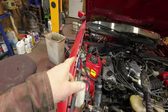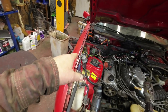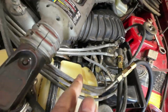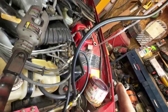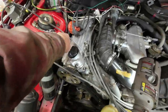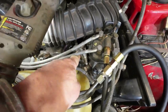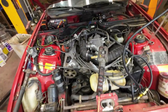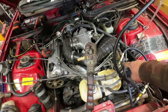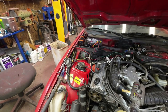Okay. Yeah, yesterday I thought I'd hit gravy with this thing, but I hadn't. Down in there, you can see that little hot start valve right down there. It seems to work right. It seems that it's correct. Now this line here is the return line. It comes over here and goes right into this, and then it should go directly back to the tank. The fuel pressure on here is controlled by how much is getting through there, and not enough is getting through there, I guess, so far.